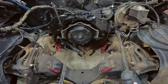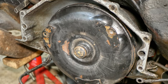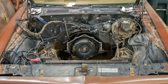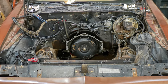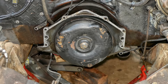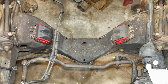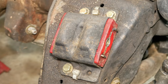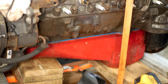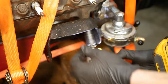We can also now see the torque converter we were talking about in the last episode, and can verify that it is in fact a 10¾-inch bolt pattern. I believe it to be a remanufactured converter at a factory style stall speed, but I don't really know much about it. The Turbo 350 transmission came with the car, and while it does have the correct tail shaft housing for a Pontiac application, I think it's probably not original. Regardless, it does seem a bit tired, and hopefully we don't immediately destroy it. Since we're going from a small block Chevy to a big block Chevy, there aren't all that many changes we need to make, and we can even keep the existing engine mounts. On the frame side are polyurethane-equipped clamshells we installed a few years back, and on the engine we've got factory style stamped steel brackets, purchased new by the car's previous owner. We'll be transferring those over to our 454 before it goes in.